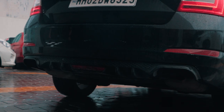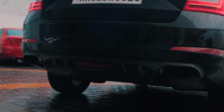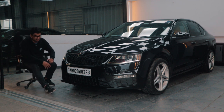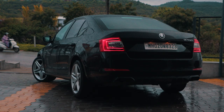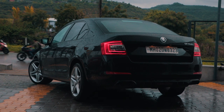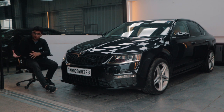The rear bumper also has a couple of tweaks done — it has a diffuser and two outlets for an exhaust system. When it comes to mechanical changes, it also has a couple of things done. For example, it gets an intercooler from a VRS245, and the exhaust system is from a VRS245 as well. So I already have the dual exit setup ready, and I just have to put on tips and probably change the downpipe when I start the build.